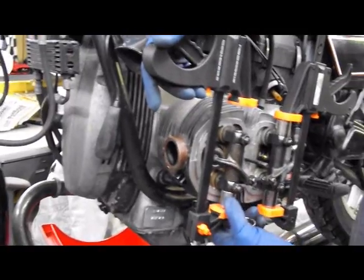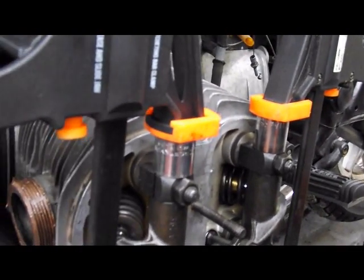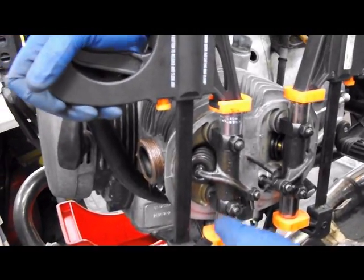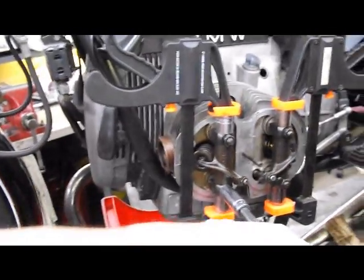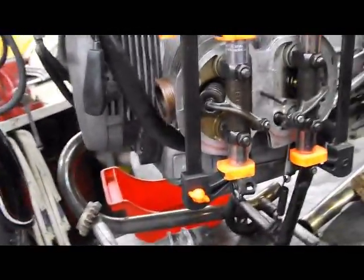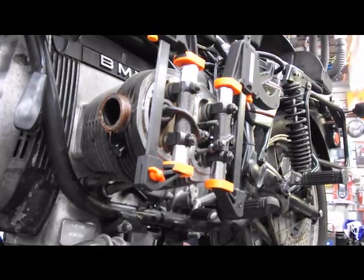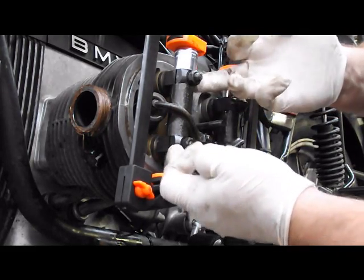Go ahead, Sean. You need a couple of clamps, carpenter clamps, whatever you use them for. You need a couple sockets that are larger than the shaft that the rockers ride on. Throw those over the top. Tighten down on the clamp. Now you're going to loosen one of the related cylinder studs. At least one. I guess I'll take over from here. What you are doing is you're compressing these pillow blocks.